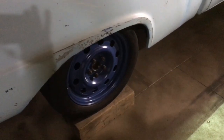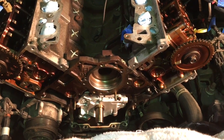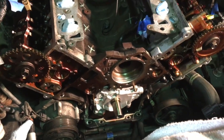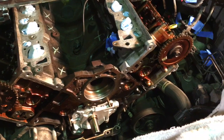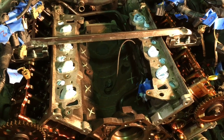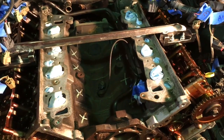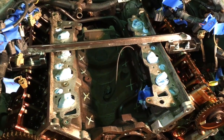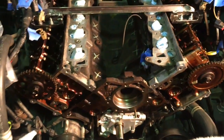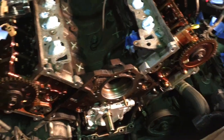The rear axle — I'll put that back together, it should be ready to go. I'm just starting to put the engine back together up here. That's a new oil pump. I heard some debate about whether or not you should do an oil pump, but I figured I was that close. Next is to get the timing chains on and start putting it back together. That is my redneck cam fixing tool to keep the cam from rotating — I heard debate on whether you actually had to have that, so I just made one up really quick. It looks like a mess, but it should go back together alright.